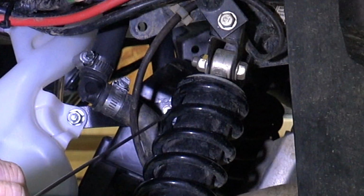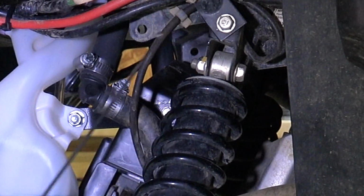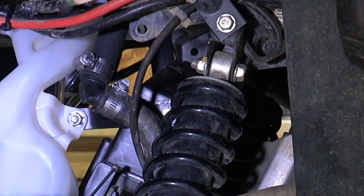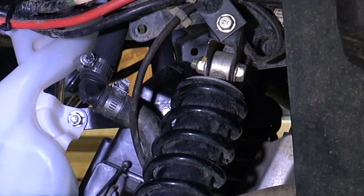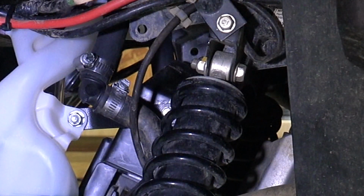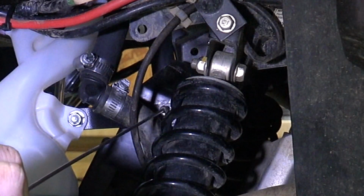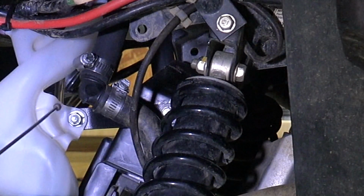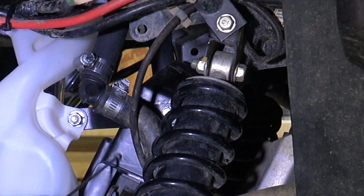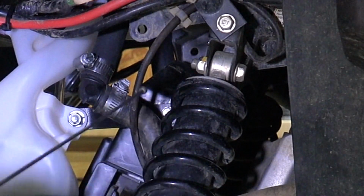This is the bolt that originally held the radiator in. The hole you drilled for your power steering relocate in the little cover, that's what this piece here is. It is laid in here, and you line it up with the hole and put the bracket on too. So you've got the bracket and this piece now going where the radiator was originally fastened.